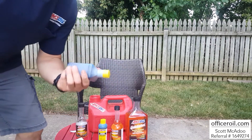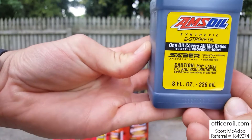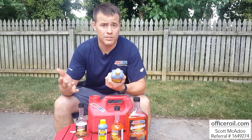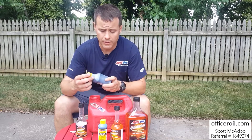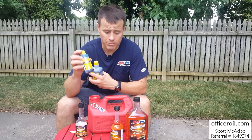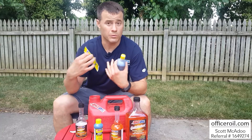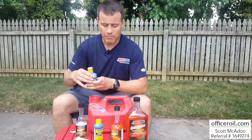What I usually do when someone asks me what they should get is simply ask: what size is your gas can? You tell me the size of the gas can and I can make it easy for you. Five-gallon can — 8-ounce bottle. Two-and-a-half-gallon can — 3.5-ounce bottle. And the one-gallon pillow pack is perfect for the homeowner, which is what I am.